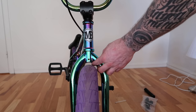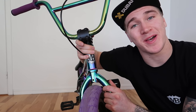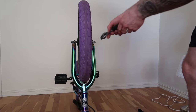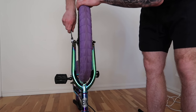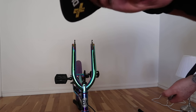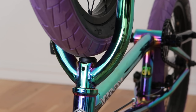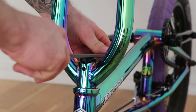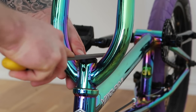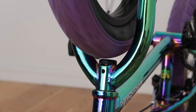Lots of foot jumps, but you keep squeezing your toe in between the tire and the fork — just like I do — and that really hurts. So what are we gonna do? Take your bike upside down, take off the wheel. We see this bar — place this bar into your fork. Your wheel might rub on the bar, so grind the bar down until it fits. See — grinded down. No more sore toes. And if for some reason it still won't fit, take some duct tape around the bar end and you're good to go.